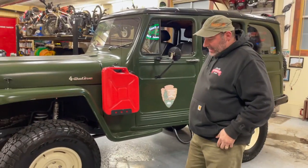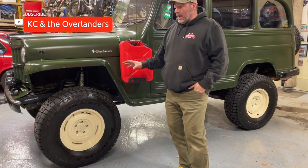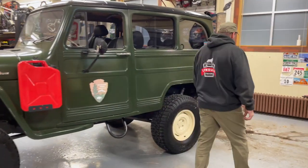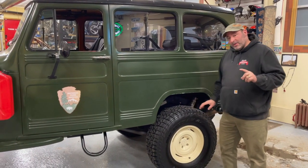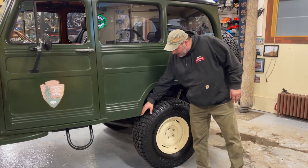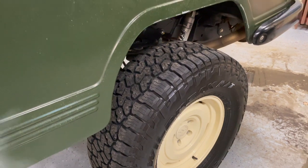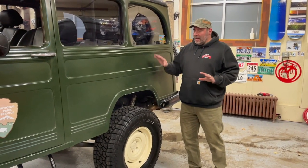As you can see, a 1958 Willys didn't come with 35-inch tires. We chose to go to a 35-inch tire — we can air it down and still go over bumps, but it's larger without being too large. We're rolling on 35s on 17-inch wheels. 35 is about as big as we could run. We thought about 33s, but at the end of the day 35s fit really well. If I ran 37s, at full travel the tire would hit the wheel well here and here, but the 35 just fits perfectly — as big as we could go without body trimming.